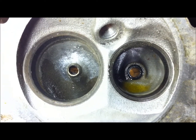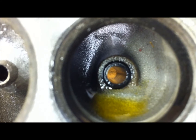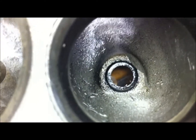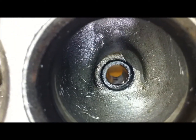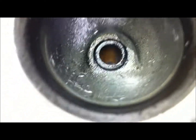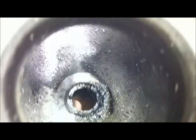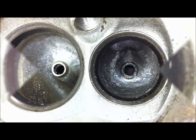Here's a little clip just to show how much meat is actually coming off that valve guide boss. There's one untouched. Let me put a gouge in the side there so you can see how much is actually coming off. Some of you may be surprised when you start biting into it and be afraid you're taking off too much — there's a pretty big chunk of aluminum that gets removed from the boss. See if you can see it, about two-thirds of the way around that one.